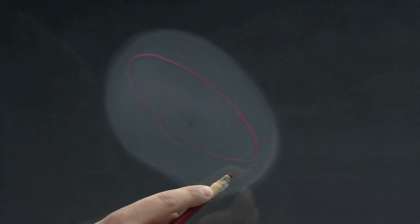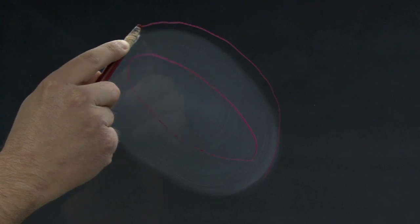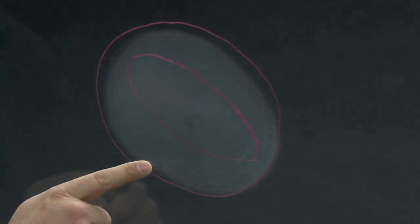Before beginning with the 320 grit, outline the cutting pattern generated by the starting disc with a grease pencil or dry erase marker. This will help to distinguish between the different cutting patterns as well as identify the amount of overlap.